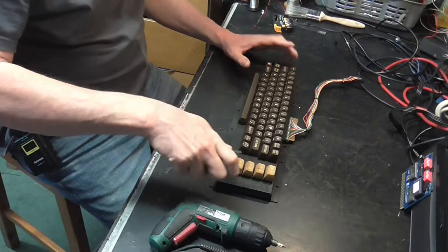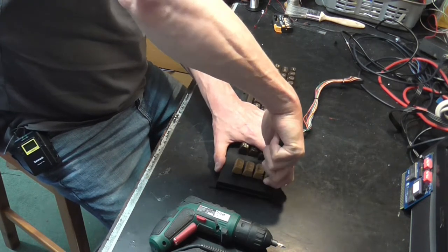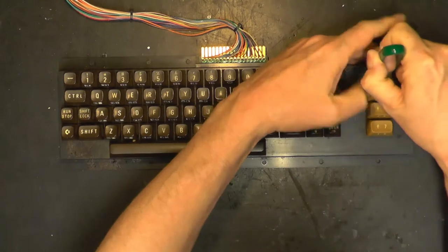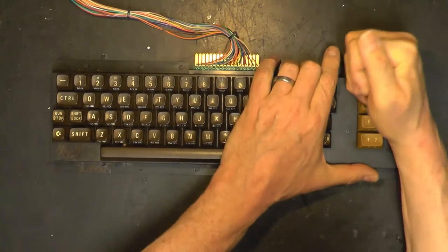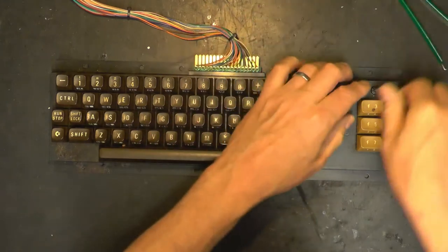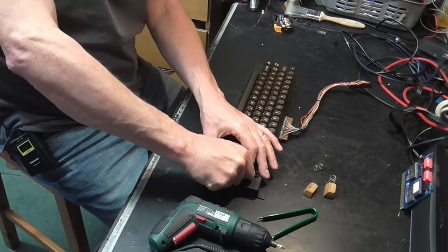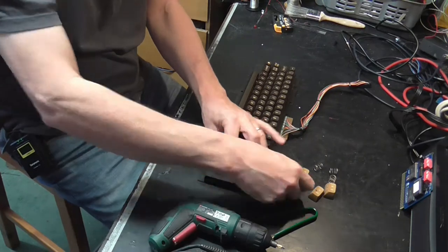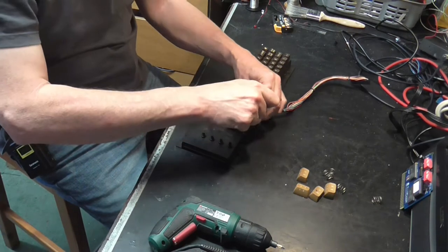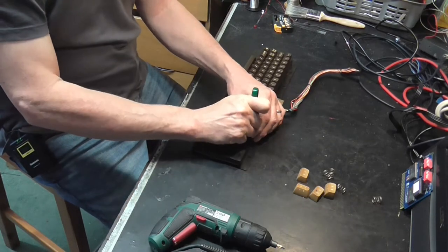So, yep, we're going to have to pull all the keycaps off. I haven't got a keycap puller, so I've always got away with using the chip puller. Although, this could be time to go out and buy one, maybe. Especially if we're going to do a few of these micros. Oh, come on. Oh, that's it. There's F1. Coming off quite easily. F3 and F4. F5. There we go. It must be said, it would be so much easier with the correct tool. Anyway,